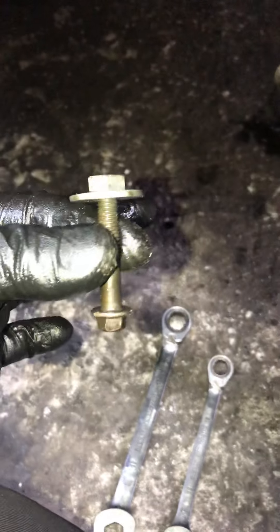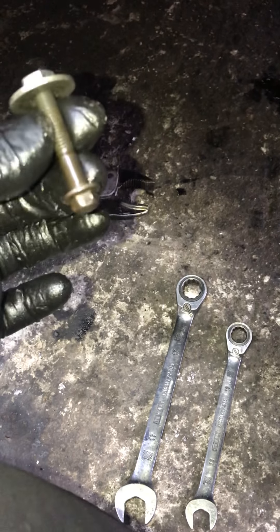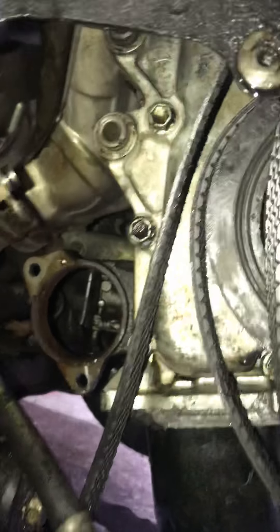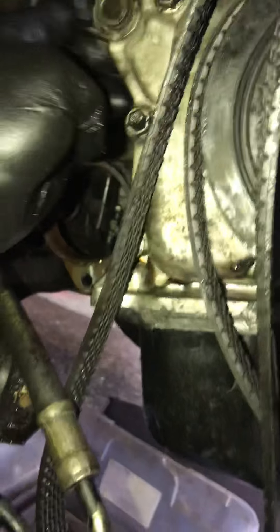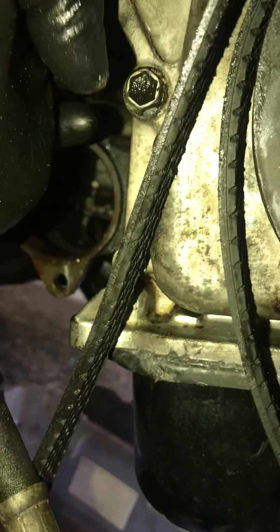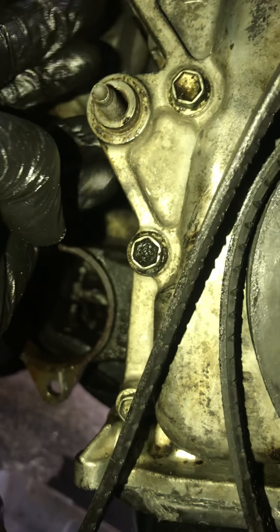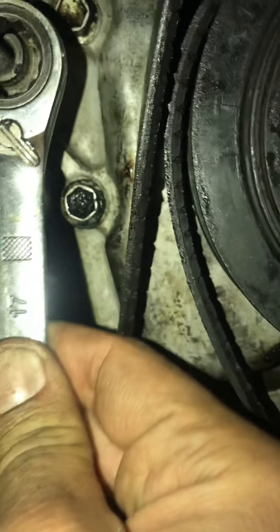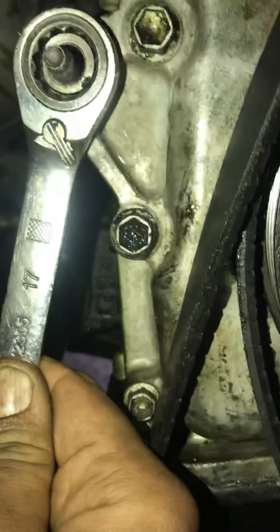Just simple tools — you don't have to buy special tools. I got this bolt from my junk bolts and nuts. What you have to do to push this thing out: you put this bolt back here like that, and then you get any wrench — 17 millimeter is good for this size. You work this like that, outside the circle.